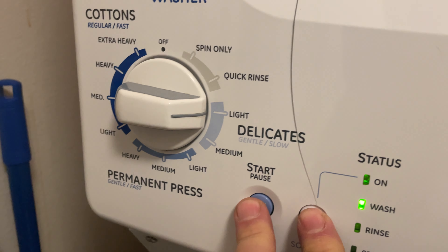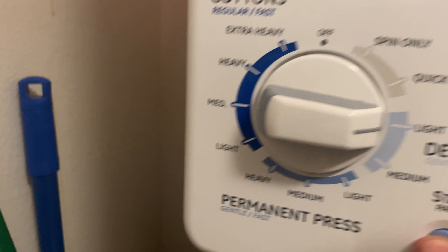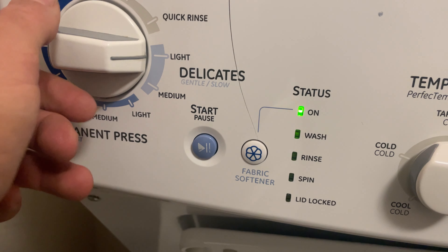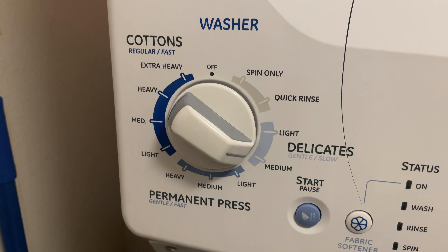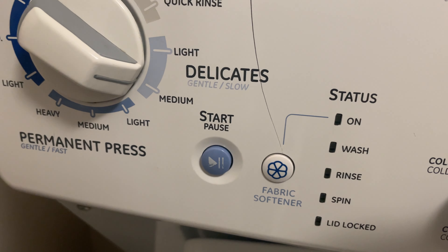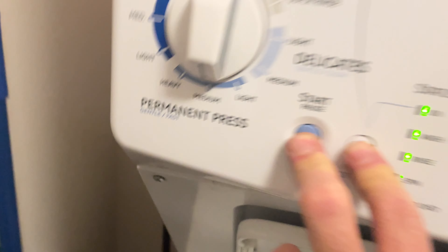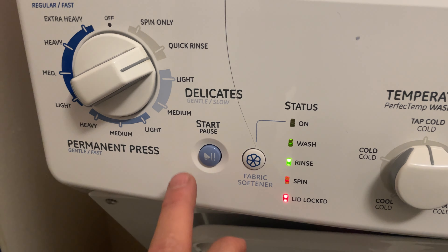Apply power to the washing machine. Entering service mode: hold down Start and Fabric Softener for three seconds, then move the dial to position six — lights are gonna blink. From there go to position four and hit Start to clear all error codes. This can all be seen in the service text sheet. Then hold Start and Fabric again for three seconds and move to position six to get out of it. I'm gonna run a quick rinse and check our repair.